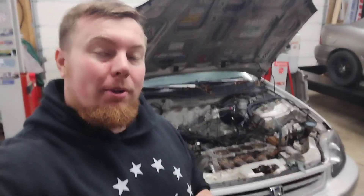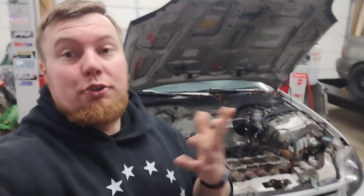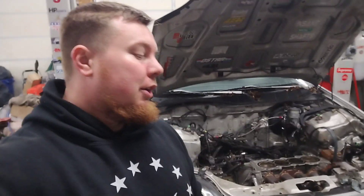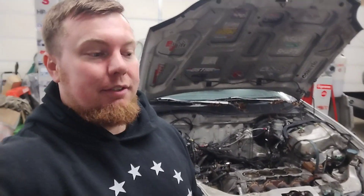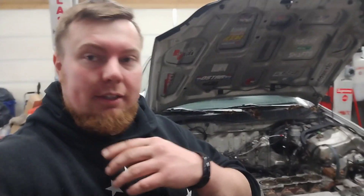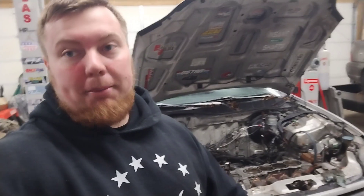As you've seen, the oil was very, very milky. I was driving this thing before I parked it — spraying it, having fun with it. It's a 12.5 to 1 compression motor, so nitrous of course creates very high cylinder pressure. The likelihood of blowing a head gasket is very high. I knew it kind of hurt the motor — I heard it make some funky noises — but it still started and ran.